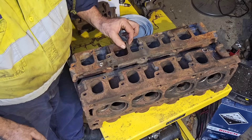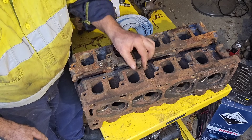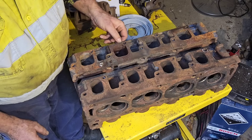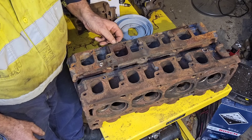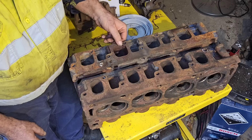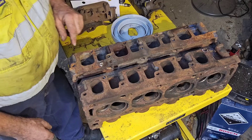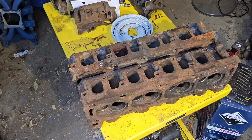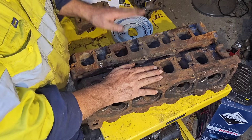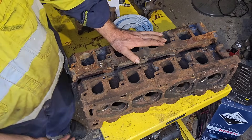Notice how thick we are here versus there — very similar. Up here the 4V is thinner across the top, but not by a great deal — we're only talking about a sixteenth of an inch, two and a half millimetres or so. We won't bother measuring it exactly. We'll probably do another video later about the differences in port dimensions, because right now we're only talking about identifying the differences in the heads.